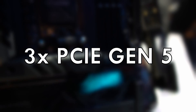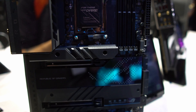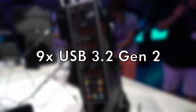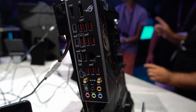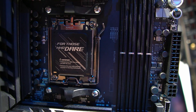Two of the five M.2 slots are PCIe Gen 4, while the other three are all Gen 5, making the board ready for the next generation of storage. PCIe Gen 5 support also spreads into the x16 slots for future GPUs. USB is plentiful: two USB 4, two USB 3.2 Gen 2x2, nine USB 3.2 Gen 2, four USB 3.2 Gen 1, and three USB 2.0 internal headers supporting up to six ports. Networking features Wi-Fi 6E and a 2.5G LAN on an Intel controller. The power solution is an 18+2 design rated at 110 amps per stage.